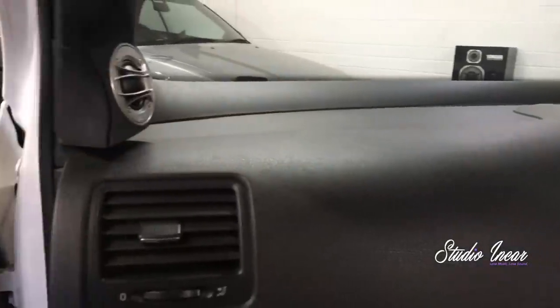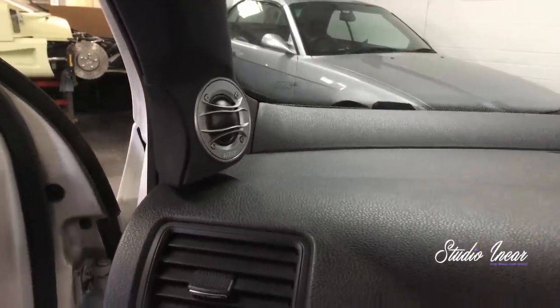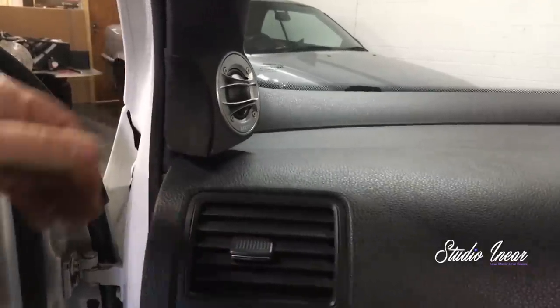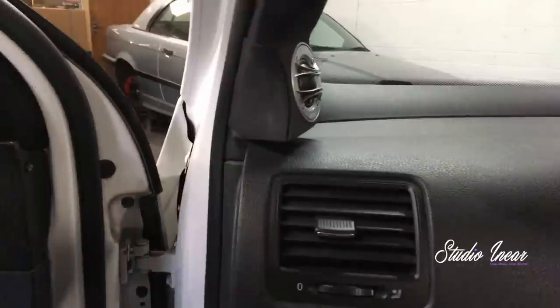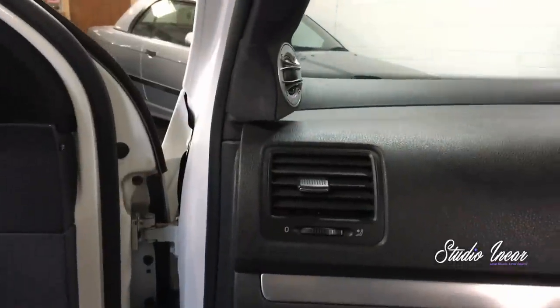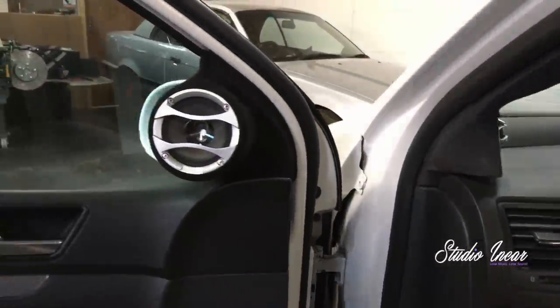Moving along to the Thesis Tweeter — the new Thesis Tweeter, the Violin 02. It's a 6-ohm driver, so a little trickier to drive than normal. I've got an adhesive neoprene pad so that when the door closes, the midrange and tweeter join together but remain decoupled from each other. It may not do anything, but it makes me feel better.